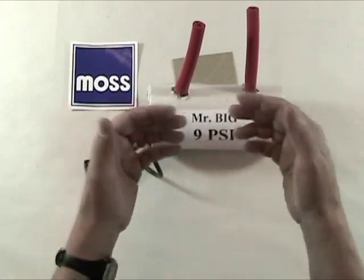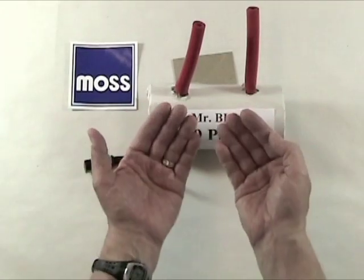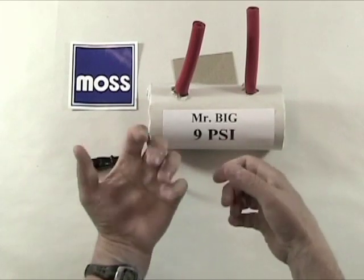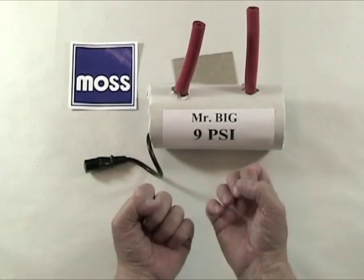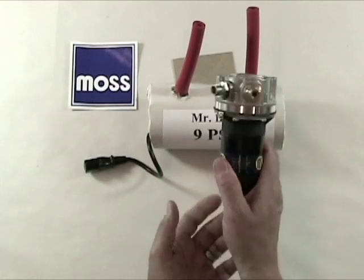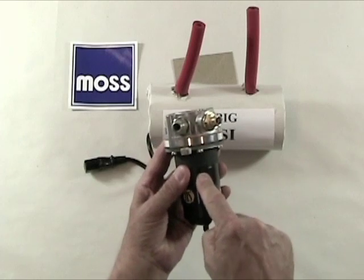The car starts and runs great around town, but whenever he tries something that demands some serious power, the pressure regulator has choked the fuel off so much that the little car can't get up and go. The gasoline in the float bowls is sucked out faster than it can be replenished. Now, the sissy little SU pump doesn't look so anemic. The original SU pump never had problems redlining the motor.